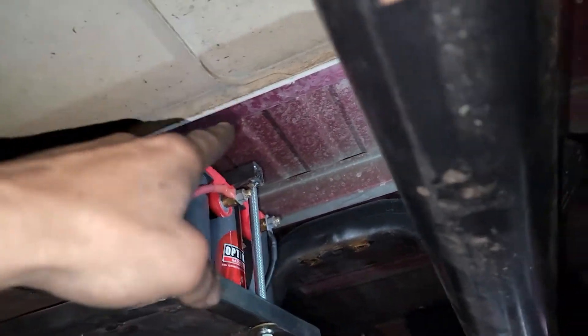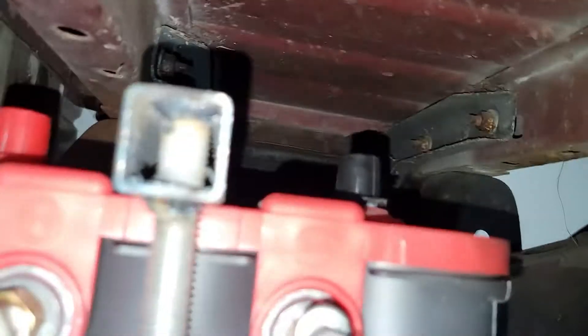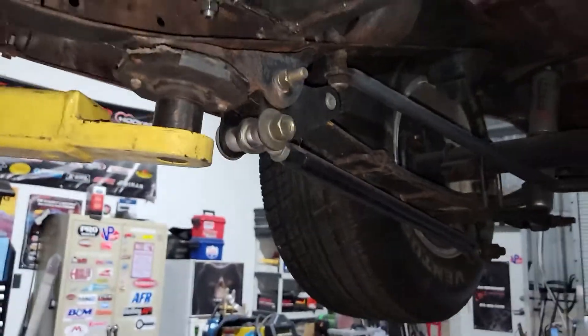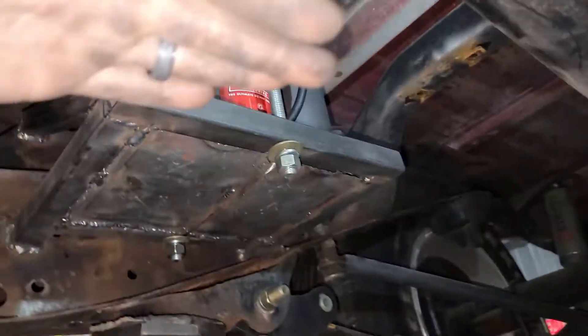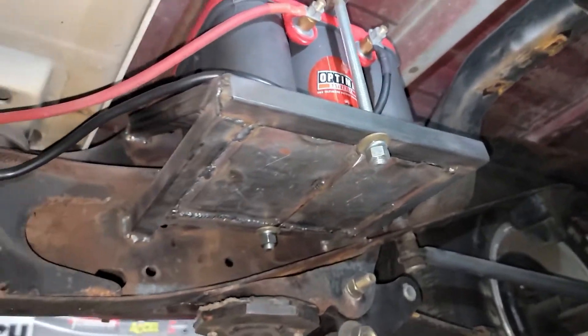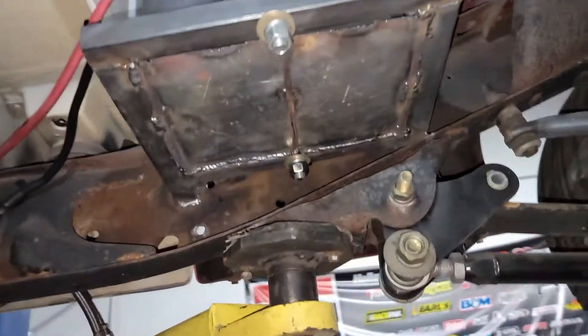For the hold-down, I took another piece of square tube with half-inch all-thread welded into the square tube on top — welded in both ends and also welded inside the tube, then welded on the bottom of the tube. That keeps the tube from crushing, acting almost like a little crush sleeve. I was super happy with it, then brought it over to the truck, set it in, used another piece of square tube to make sure it was square in the frame, tacked it in, and made the rear gusset to go to the frame rail.